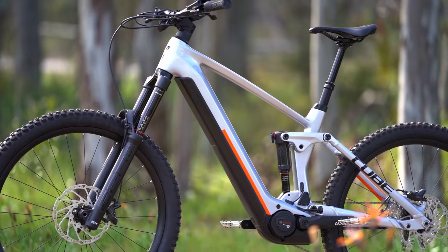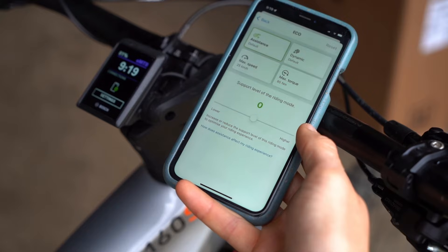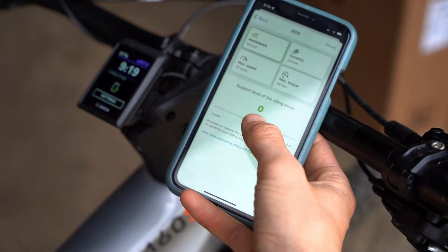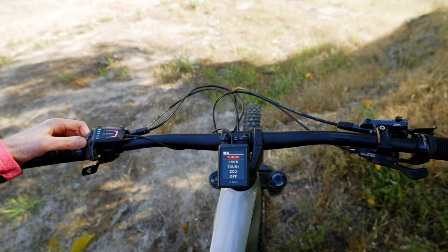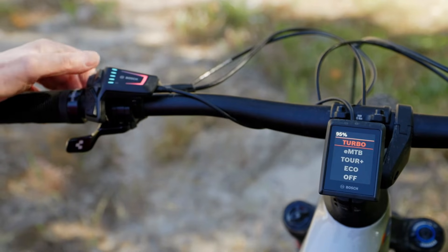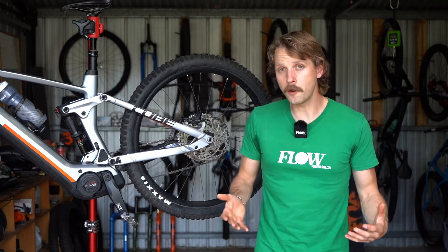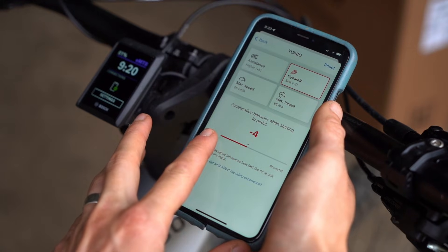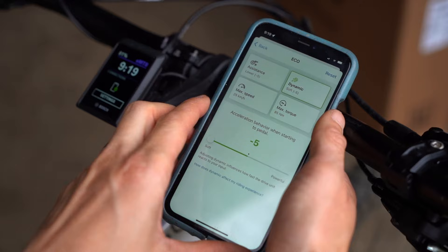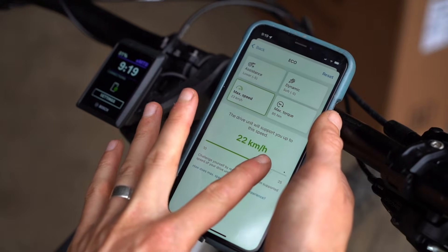Number four: tuning the motor. Where things get really interesting with the eBike Flow app is the ability to custom tune the motor's performance. There are four attributes you can adjust: max power, acceleration, support level, and maximum riding speed. You can't adjust those levels in Tour Plus or EMTB modes because those are dynamic assist modes that automatically adjust output based on rider input. You can tune the Eco and Turbo modes, however, which is useful if you're chasing a different support characteristic. For example, changing the acceleration and support levels makes quite a big difference to how quickly the power comes on — especially for lighter riders or those newer to e-mountain biking who might find the motor a little too full on in stock settings. Detuning the acceleration and support level is a great way to soften the overall output, while other riders looking for more of a workout can detune the motor and restrict the maximum speed to make sure they're doing more of the work.